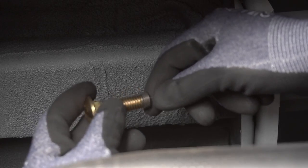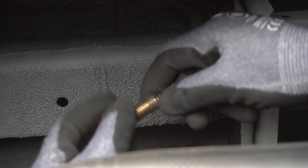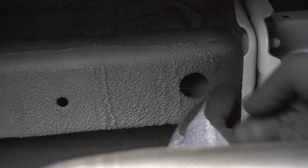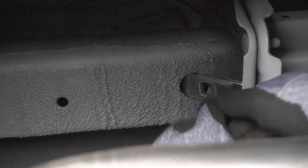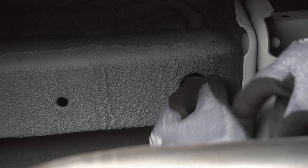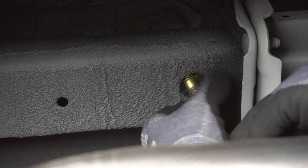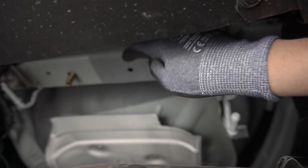After that, unscrew the pigtail and reverse it — put the bolt inside the pigtail first, then feed it right through the hole, then feed the bracket through the hole as well. After that's done, you should be able to pull it over and through that bracket. Once done, it should look like this, and whatever you did on this side you're going to repeat exactly on the other side.